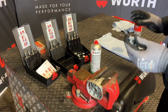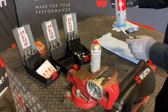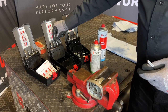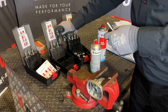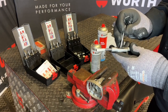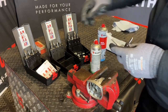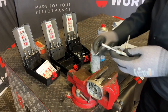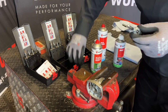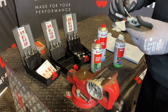Remove the tap. Remember to clean it again. I favor brake cleaner for cleaning any cutting tools because it flashes off quickly and it doesn't attack your cutter. Then your inserting tool — put that again in your tap handle and secure it. Put a little bit of multi on your inserting tool before you put your Timesert onto your inserting tool.